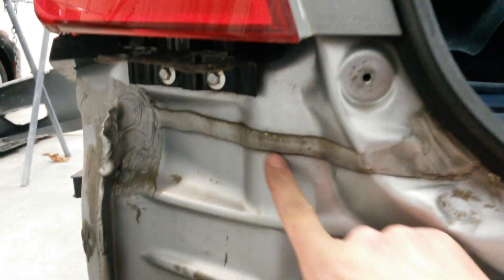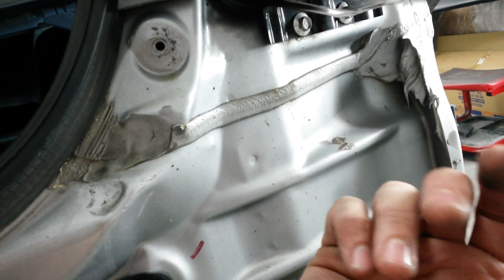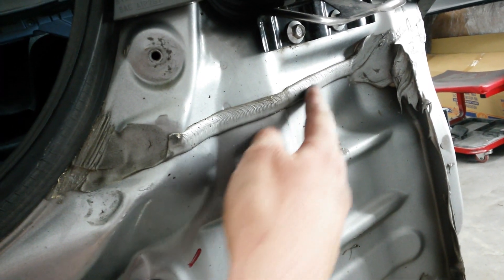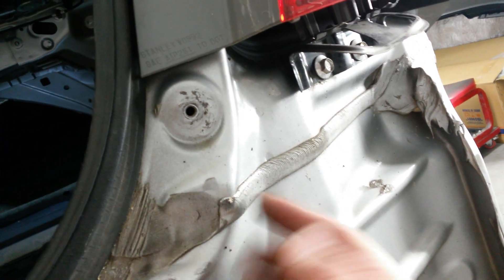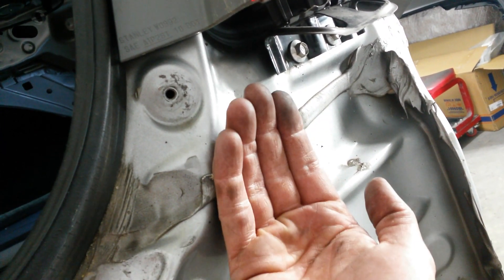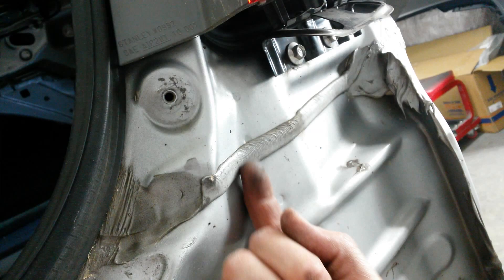It runs around the outside at this seam and down to the pinch weld right here along the quarter panel, then underneath along the floor over here and the spare well along the other side and back around. This is actually lapped on the inside — I'm not sure why they made it that way. It makes it really hard to get this out; you have to rip all the seam sealer off here. I'll probably just drill all the way through this from the outside, because when I get the new piece it's going to go in behind this and I'll be able to plug weld on the outside to the new piece that's underneath.